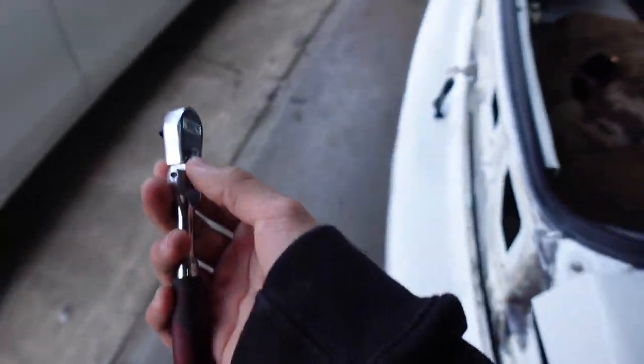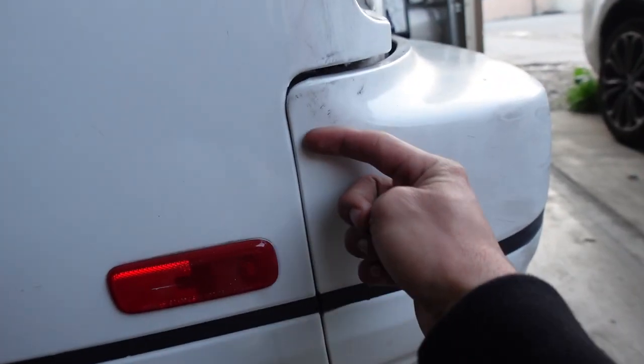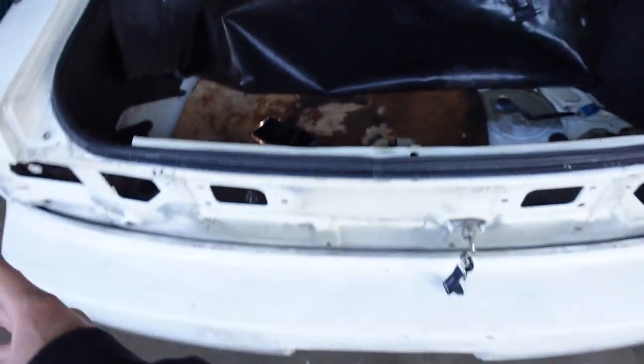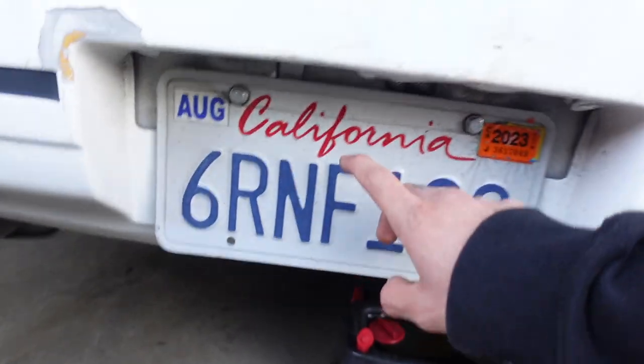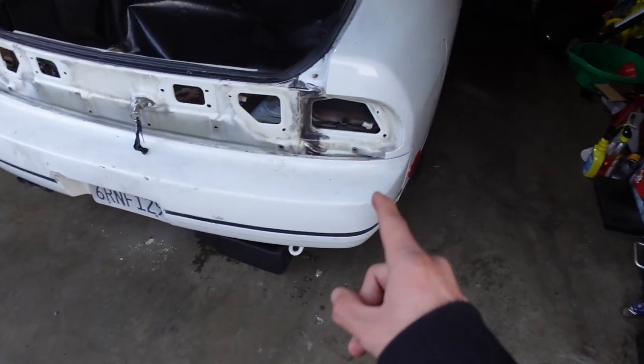There's going to be three bolts on each side. I'm going to use this tiny quarter-inch drive ratchet to stick my hand in there and remove them. There are three on that side and another three on this side. After you take out the three bolts on each side, you're going to come inside and there's going to be four grommets. You take these grommets off and there's going to be a 14-millimeter bolt under each one. Take off those four bolts and the three on each side and the bumper should just slide off. Be careful because there are wires in there — unclip those and then the whole bumper should come off. There's no way I'm taking off that interior again.